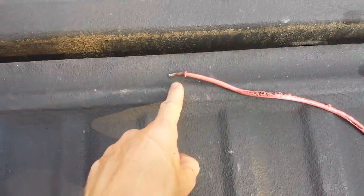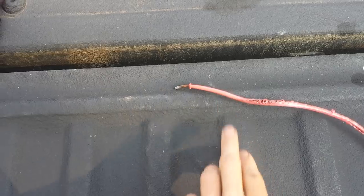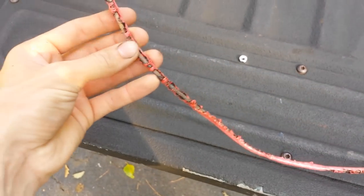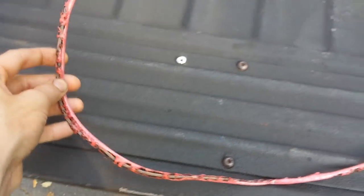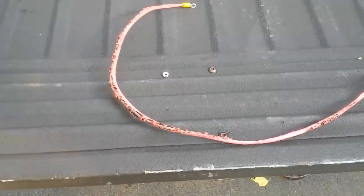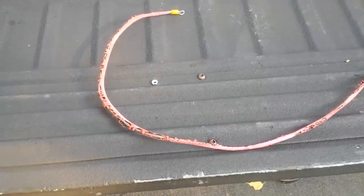So what had happened was, as you can see, somewhere a short circuit developed and on this end it actually got so hot that the solder on the ring terminal melted — and that's actually how the circuit ended up breaking. But you can see it just totally melted the insulation here. It's ready to come off at this end closer to the battery, and you can tell by the color of it, it got very, very hot. So the owner of the vehicle is lucky they didn't have a serious fire.